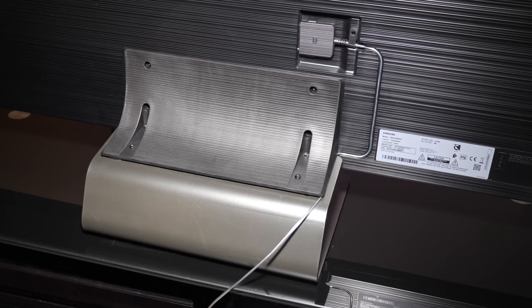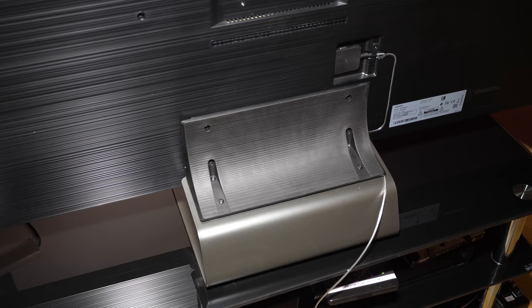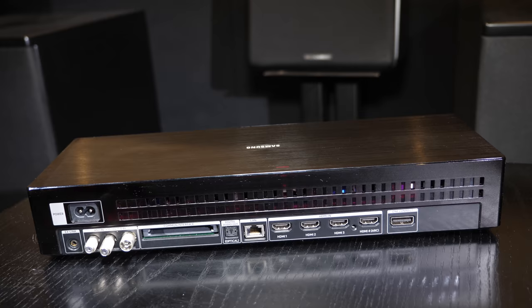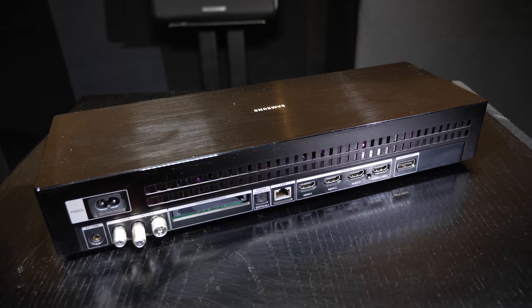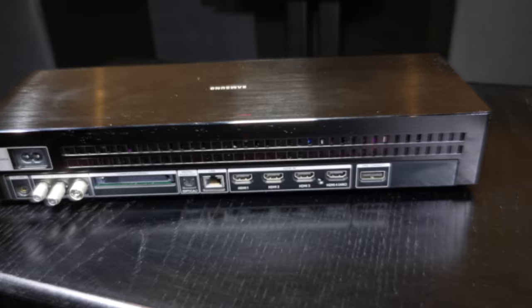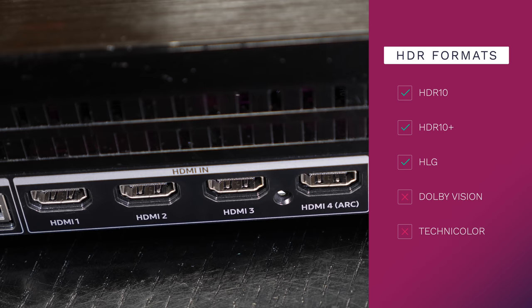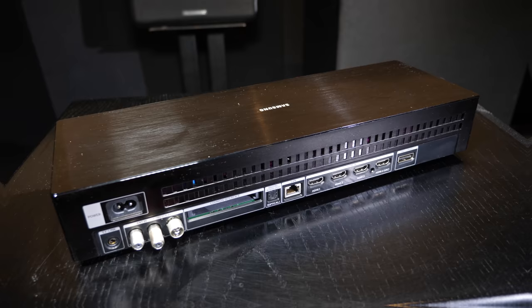On a normal TV you'd find all connections around the back to one side, but Samsung do things differently with their QLED TVs — there's just a One Connector to the back and a thin cable leading out to the One Connect box. This unit has all the power, Wi-Fi, and connections for the TV. It can be hidden away for a clean installation with less of a spaghetti junction look to your cabling. There are four HDMI 2.0b ports accepting 18 gigabits per second 4K 4:4:4 60p signals with compatibility for HDR10, HDR10+, and HLG high dynamic range formats. There is absolutely no support for Dolby Vision.